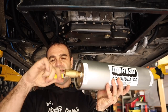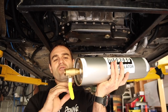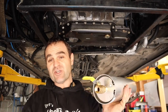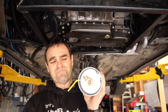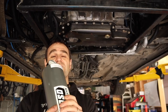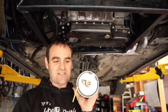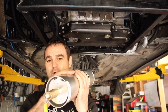The other added benefit is that because it has a tap on it, if you shut it off before you turn the engine off, it's filled with pressurised oil. It can actually help your engine on startup — you can crack it open to pressurise and force oil through the engine, so when you start it up you have a nicely oiled system. You just have to manually remember to turn it on and off when you start and shut down the engine. You can get electronic ones, which makes them about double the price. I'm going to fit this in the cabin of the car — that's where most race cars mount them so you can actually reach them. I'll find a spot behind the passenger seat.